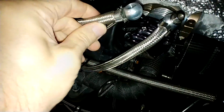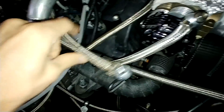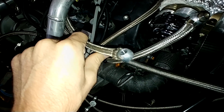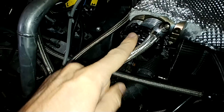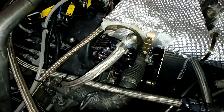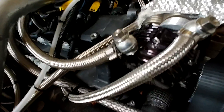What I'm doing now is putting this back in with the banjo bolt. That way, this line comes from the pressure of the first turbo from the cold side. As that builds to about seven pounds of pressure over ambient, it will push back on this piston and hold it in longer, giving me that extra three pounds of boost that I had before.